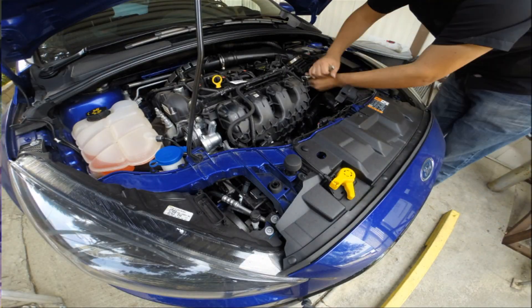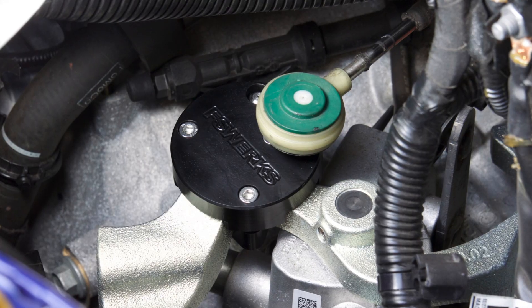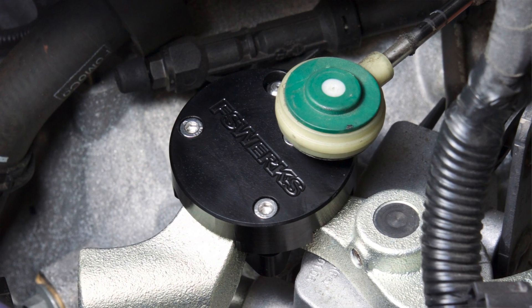After that reinstall the intake box and you're good. Driving it, it's a huge difference. I love the way it feels — it's just quick, click click to get into the gears instead of a longer throw. Not really feeling that confident once you push it in there on the stock setup, but this way it feels so much better. I'd recommend going 40 percent if you do install one yourself. I don't really see the point of having a short throw shifter if you're just going to do it by 20 percent, but we all have our preferences.